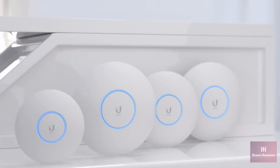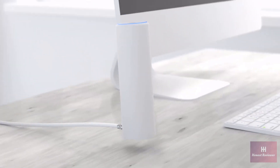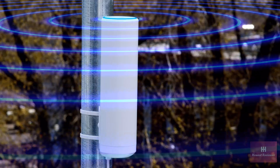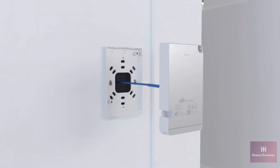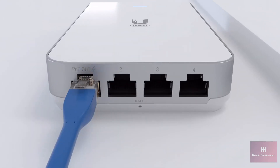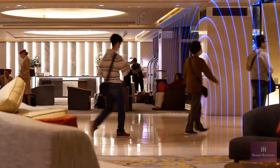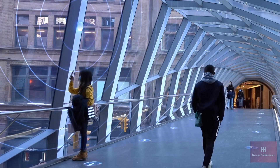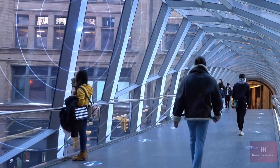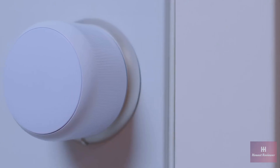In addition to ceiling-mounted, UniFi 6 will also be available in versatile indoor-outdoor form factors. The U6 Mesh is best for flexible deployments, indoors or out. The U6 InWall transforms an Ethernet wall outlet into a four-port gigabit switch with a PoE port that can power your UniFi device, best suited for hotel and hospitality deployments. The U6 Extender is a plug-and-play mesh AP, perfect for anywhere PoE may be difficult to access. All U6 APs support Bluetooth low-energy for plug-and-play connectivity with UniFi IoT devices, including sensors and door locks.